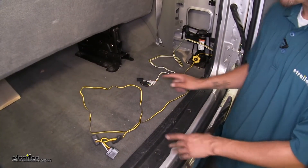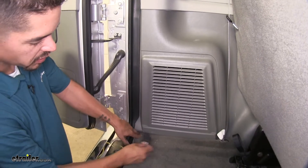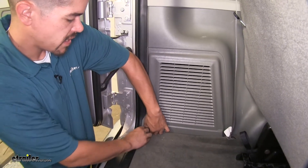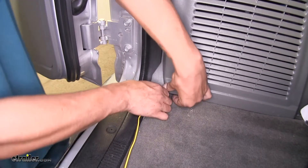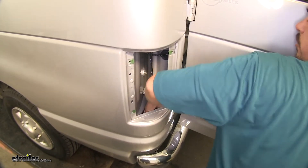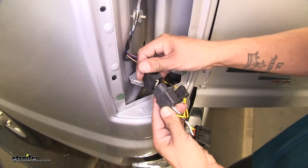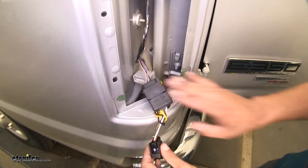We're going to leave our four-pole wire here for now and start to route our yellow wire over to the driver's side. Over on the driver's side, this plastic panel can go right underneath it, giving us the same opening to the outside taillight there. I'm just going to push my connectors underneath that panel and start feeding my wire through until I can reach it from the outside. Then I'll reach in to the same hole that we did on the other side and pull out our connector, plugging our female end into the male end on the vehicle and making sure it locks into place.